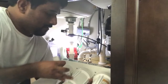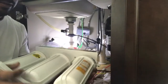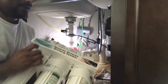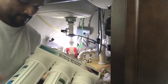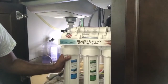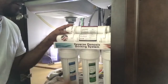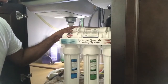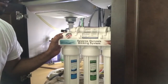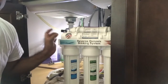Now for the last part — I'm going to tighten them all. Make sure you tighten them properly, otherwise they're going to leak. For some reason the pre-carbon housing is pretty tight. With that, all the filters are replaced except the RO membrane filter — I don't have that in the bulk order I received. I'll need to replace that at a later time. For now I've replaced everything else, and I'll make the connections and check for leakages before mounting back to the wall.